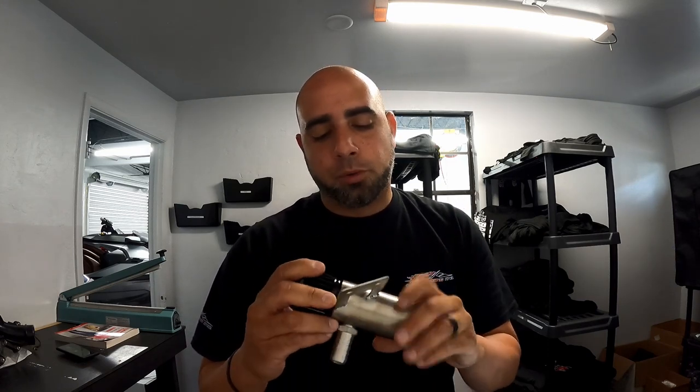So make sure on the oil level, you wanna have the dipstick, there's two bend marks. Right in the middle of the two bends is where you want your oil level. So I'll show you guys live out there on an actual dipstick so you can see what I'm talking about. But for the most part, this can is pretty much 100% right now. I don't see any design changes coming to this anytime soon.